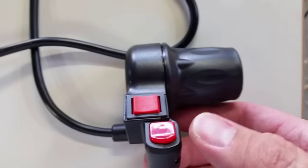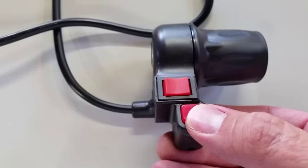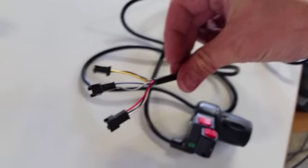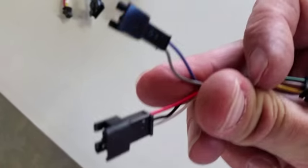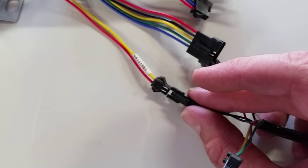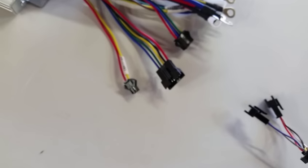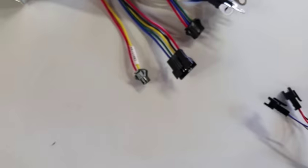If you purchase our throttle in conjunction with our controller, the throttle does have an on/off button — the bottom push button is the ignition or on/off button. At the end of the throttle is a connector with two wires: a blue and a gray wire. You simply plug that into the ignition connector and that turns the unit on and off by pressing this button. Alternatively, you could hook up a key switch or permanently enable it with a simple jumper, but we highly recommend purchasing the throttle.